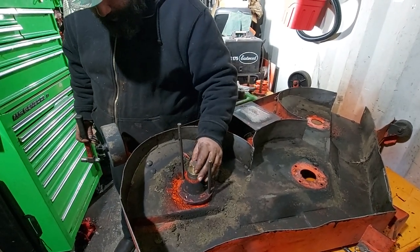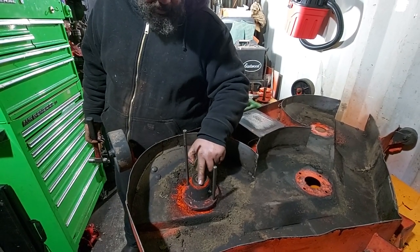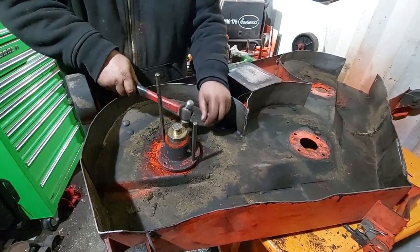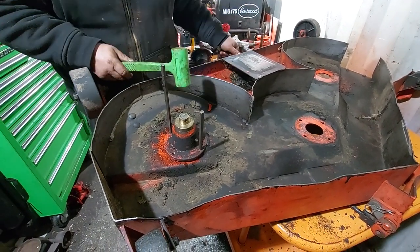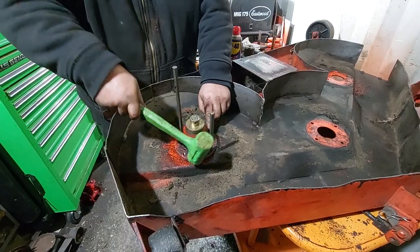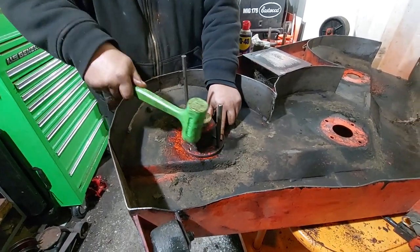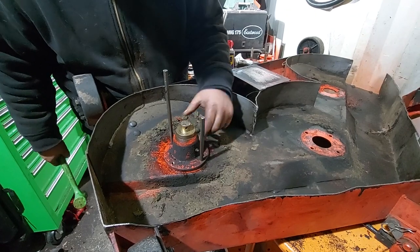You can use a bigger socket if you need to — that way you're pushing on the cast part — but just don't go too crazy because if you break it you don't necessarily need to drive them in by the bearings. These should go in pretty easy. You may have to tap around the outer side, but remember it's cast. If they start going crooked you've got to straighten them out. Always tap on opposite sides. Make sure it's all the way down around — the holes are close enough to line up.